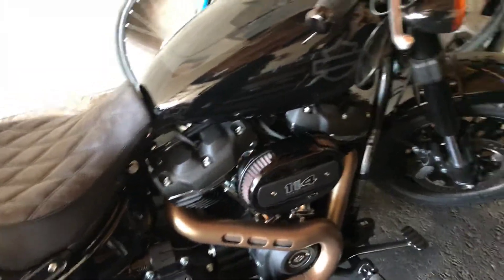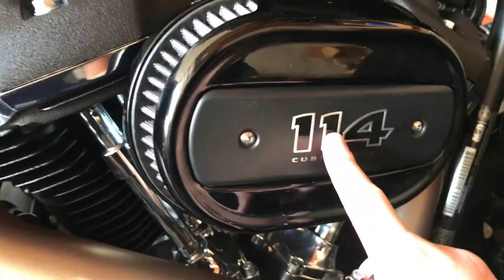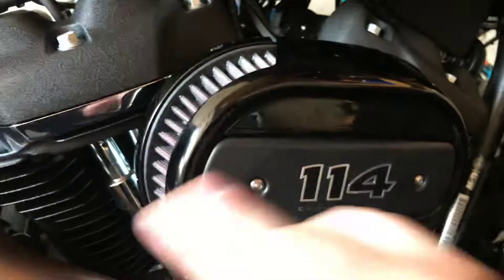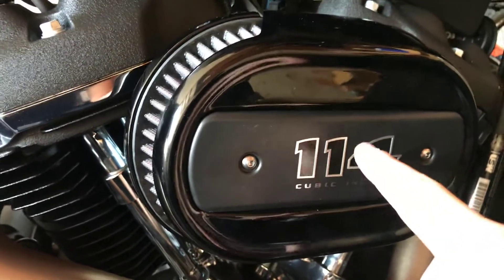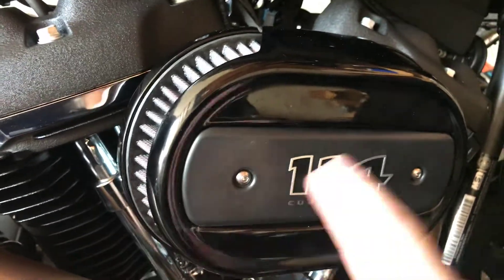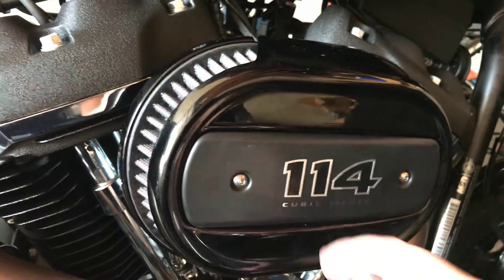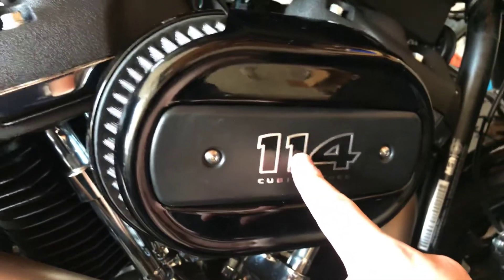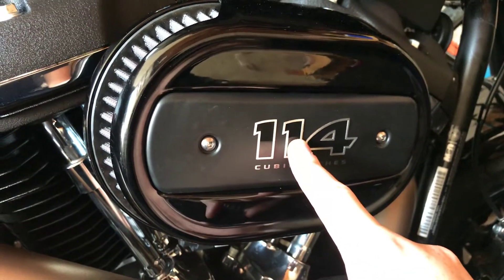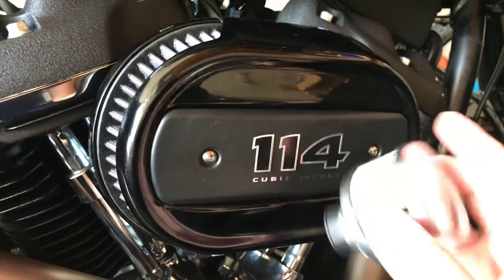I'm actually going to run a breather system. I got my breather kit and what I've decided to do is take the hose from the breather kit and on the 114 stock air cleaner, behind this little plastic plate, there's actually a hole. You can get other covers that would just be a single bolt, and the Cannon air filter has a threaded prong in the middle. I'm going to take my stock air filter and use the hole already in the metal plate to breathe externally — run the breather holes right to it. I have a brass T coming, a 1/4" tee to a 1/8" thread, with both a male and female tee to see which works better — whether it's better to thread on female-to-hose or thread on male-to-female to see how it clamps better.